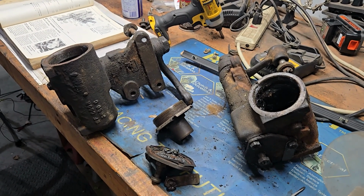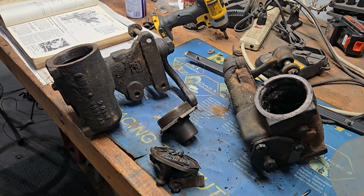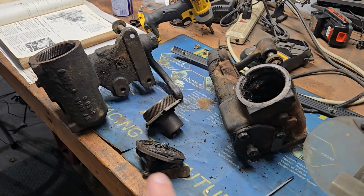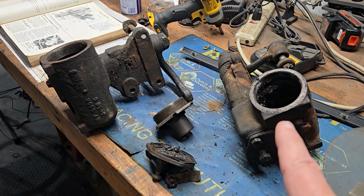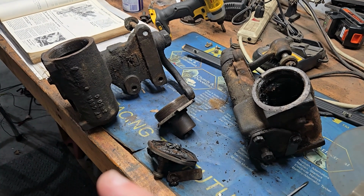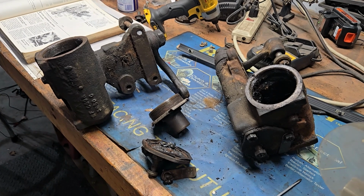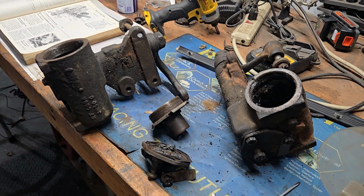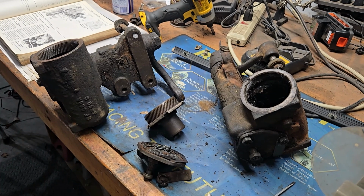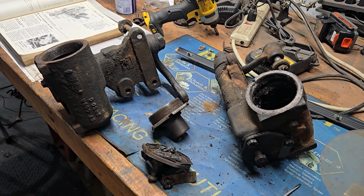You will need to access and obtain all of the necessary power steering stuff, which on these cars doesn't have the power steering running through the box, it doesn't assist it that way. Ford uses a ram system on the steering linkage on the car instead of running the fluid through the box and having the box assisted. So basically you turn the wheel, and as you turn the wheel, the hydraulic ram on the steering linkage helps push the steering the way you want it to go.